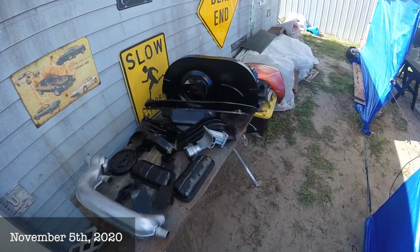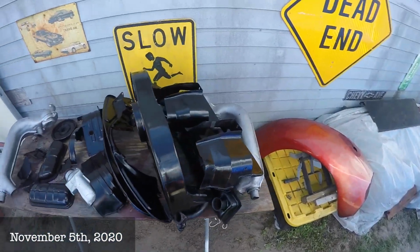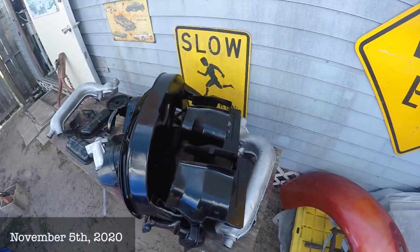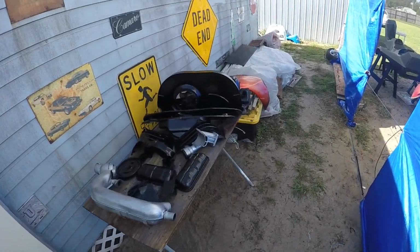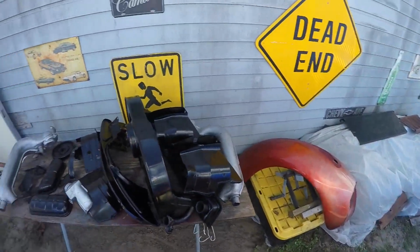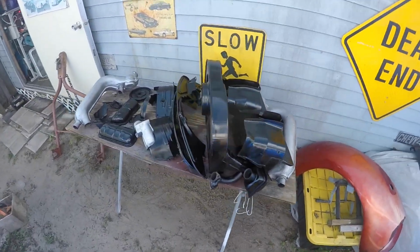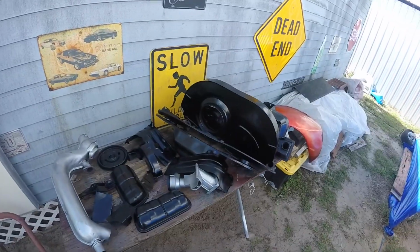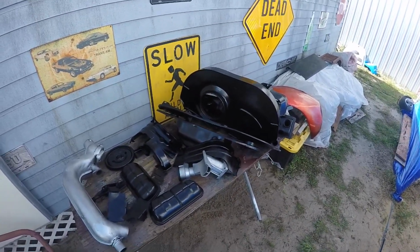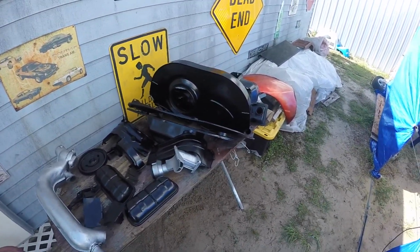All right guys, here's all the tins painted for the 1965 1200cc, which has been upgraded to 1500. We're putting 83 millimeter new pistons in it. It was kind of a budget build, only had 55,000 miles on it. Decent end play, and one piston ring broke or something. It wasn't broke on it, but maybe somebody put it back together that way.